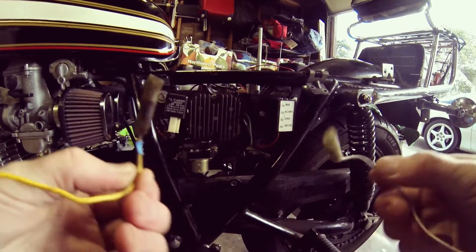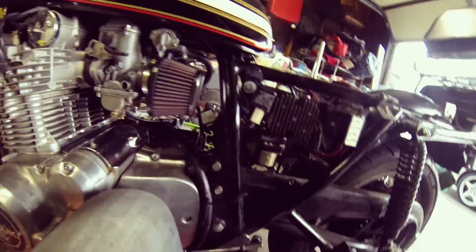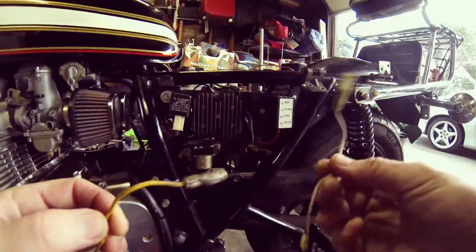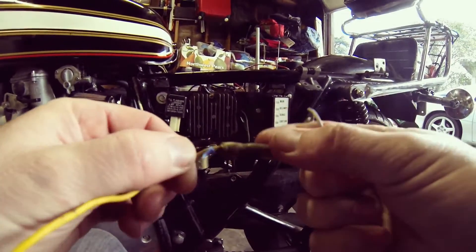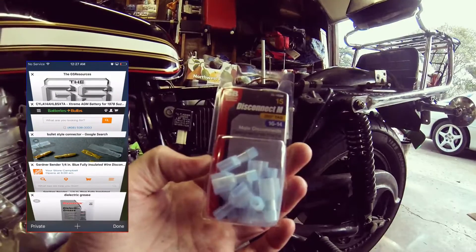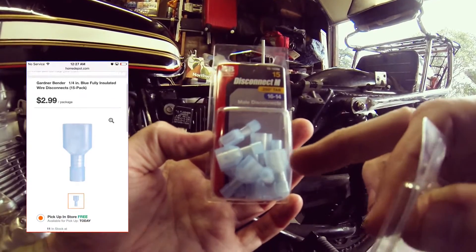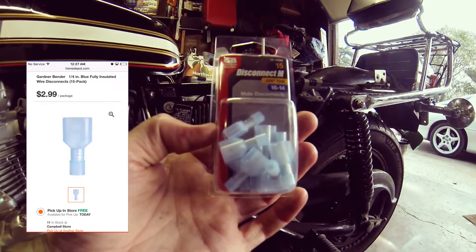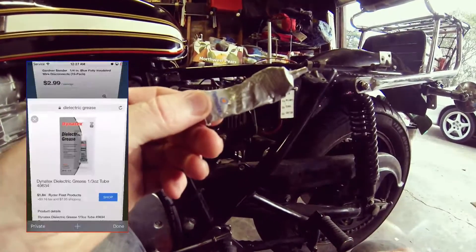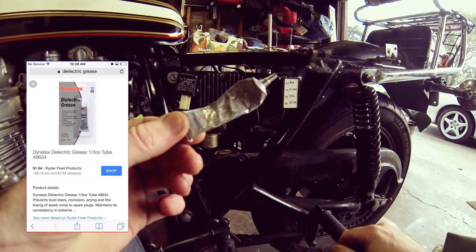This connector type has a female and a male end and it just goes right in. All I got is females basically — one end would go right inside there and connect. You can see it's all kind of black and gross inside there, so I replaced them. These aren't the best but they work, and they work better if you solder a little bit of the wire lead. I added a little bit of dielectric grease — this stuff's good for electronics, always good to put on your electrical connectors. Connectors are your enemy.